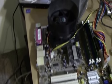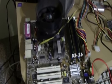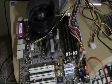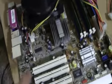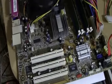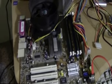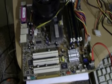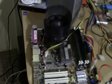Now what you can do, you can actually build a unit. If you get a box and you get all the parts, we're talking about brand new, what you can do is put this whole unit together, put your memory in, put your CPU, put your fan, put all your other stuff that you can get in there before you actually put it in the box, because once you put it in the box, it's really hard to get to some of these connections. So this is a good chance for you to learn to see how this actually works. That's why you're using a $15 computer, to see if you can actually do it.